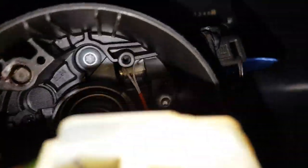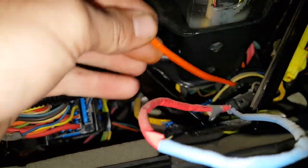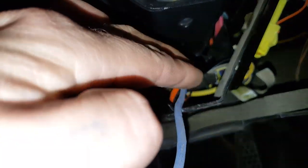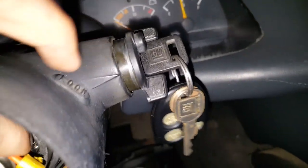After removing that screw, this thing is free and can move. But you see this orange wire right here? You've got to follow that orange wire. I took the panel off and right underneath there, somebody already cut it on this car. What they did is bypass the VAT system and added resistors right here. So the key that came with the new ignition should just turn over. These keys have a chip in them and you can take a multimeter and find out how much resistance is in the key.